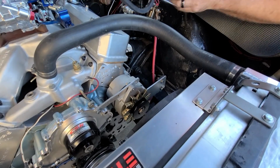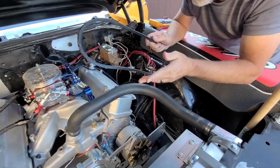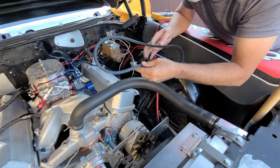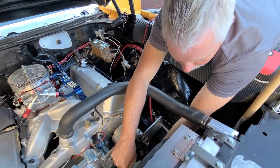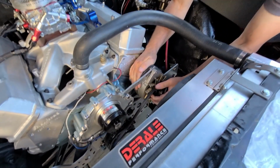Holy crap, this is a... So those belts are a 15 series. I forget what they're called, it's been too long. But those are a 15 belt. This is a 17. This is too wide, so it's going to defeat the purpose of our deep alternator. But if it'll go on here, we can change it later. This is just going to answer questions.